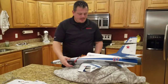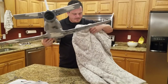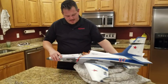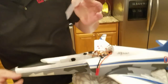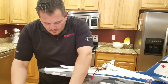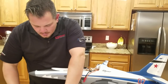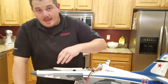Now what we're left with is a giant wire bundle to situate - that's the next thing to work out, getting this bundle plugged together. My bag is empty so all that's left is the bind plug. The wiring channel assignment: throttle is channel one, aileron is two, elevator is three, rudder/nose wheel is four, retracts are five, and flaps are six.